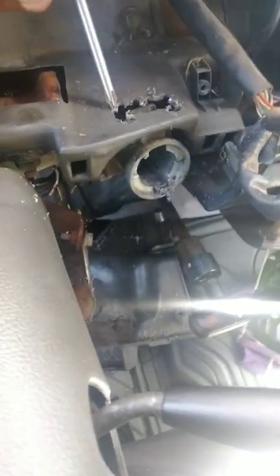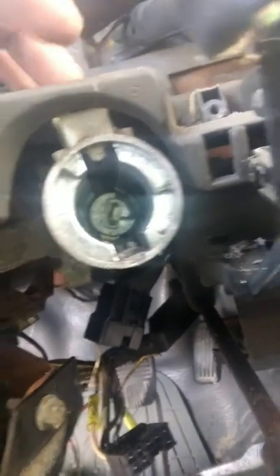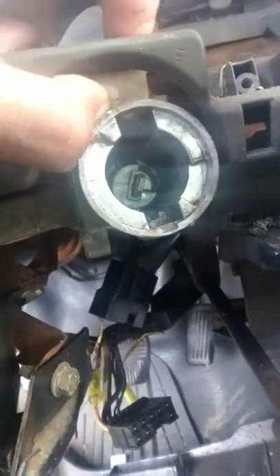With some more drilling I had to come to the side a little bit — the bit would kind of go in front of it. Now I'm able to reach my screwdriver in and unscrew it. I'm unscrewing it now and I can unscrew both sides and be able to get this out. All loosened — got the screws out. Make sure you take them out completely before you go pulling this out; take them out one by one so you keep track. Put them in the ashtray. Push this button up, pull it out — see it comes out like that. It won't come out all the way unless you cut the zip tie that's right on it.